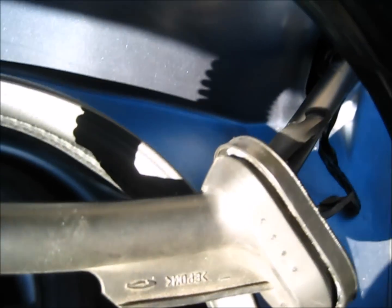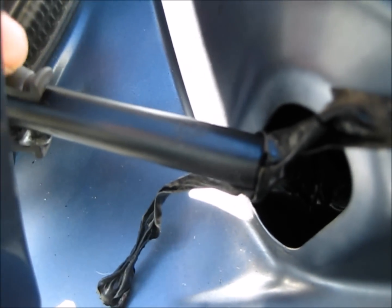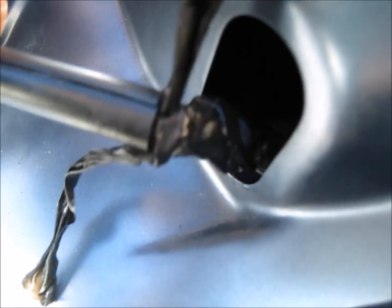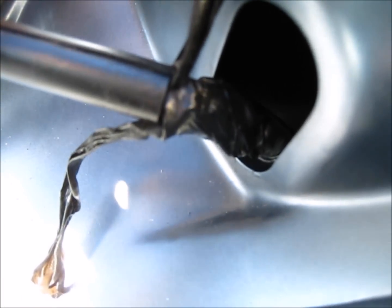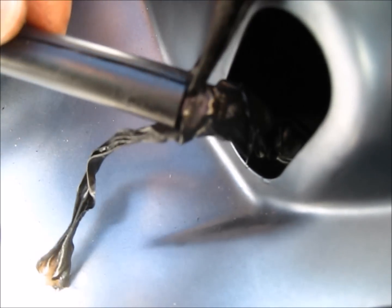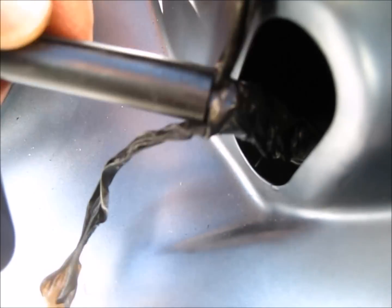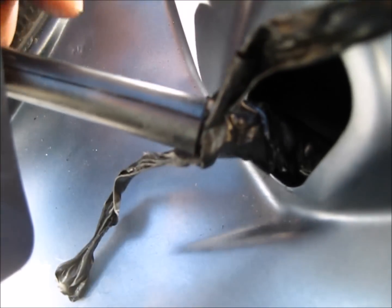It's going to be pretty difficult to fish a wire through this little conduit here. Actually, there's a rigid plastic tube in the middle. Don't try to fish through it. It actually splits open in the middle. It's just taped up. You can't see it normally. So just cut open the tape that's already on it, open it up and put the wire through it. It makes it a lot easier.